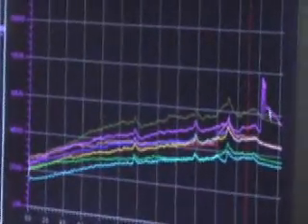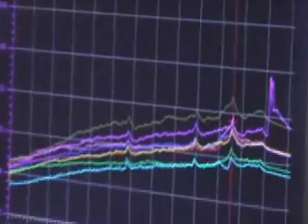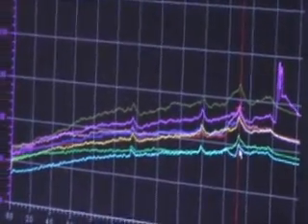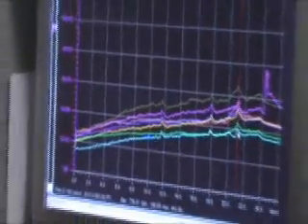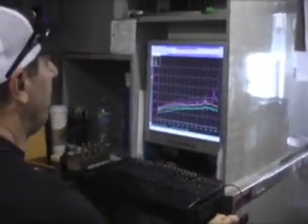These are all the EGTs for all eight cylinders right here. You can see that all the cylinders are fired and revved up real good. All the cylinders are reading probably 500 to 600 degrees when I wrap it. That tells us that we're hitting on all eight cylinders — we don't have a spark plug wire loose or a bad plug in the car.